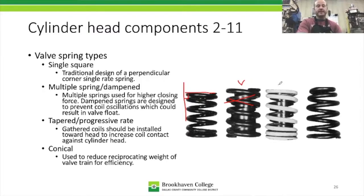The next style is a progressive rate or tapered spring. It's tapered not because of its shape but because of its pitch. If we measure the pitch, we can see that across one section we have three coils spread apart, but at the bottom the coils are much closer together — that's the taper in the pitch. One of the biggest reasons for this is that it creates a much larger contact area against the cylinder head at the bottom, giving the spring more support.